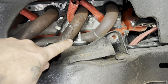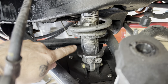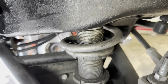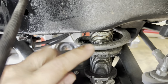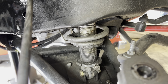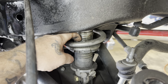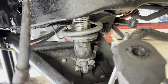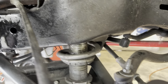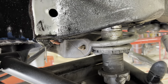I had to take the arm out because I've got to change the spring. I'm gonna adjust the collar down. This is just way too much anti-seize, guys — you can see all the debris sticking to it. I thought it was grease but it's anti-seize, just got so much dirt on it. Once you put the setup in the car, adjust the collar up to where it's gonna be close, bolt the ball joint in, then put the anti-seize on top of the adjustable collar threads — just a little bit. Anti-seize is expensive and this is what you end up with: dirt everywhere.